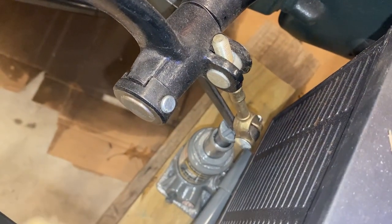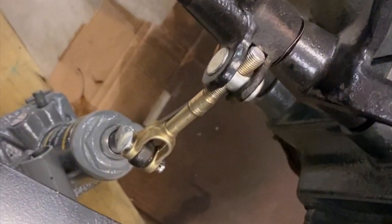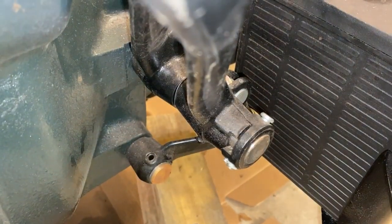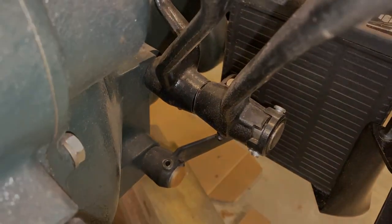Turning the rod counterclockwise to decrease the play, we brought it down to just about 1 inch of clearance before it started to disengage from the clutch. With our adjustments made, we reconnected the clevis rod to the clutch actuating arm, replaced the pin, and lowered the jack.